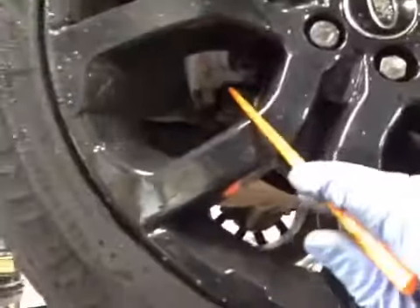This is the passenger side front tyre. The tyre is below 5mm, so this tyre is in amber. Your front discs are in okay condition. Your front brake pads are roughly about 7mm, so pads are in green, disc in green. Your tyre is in amber.